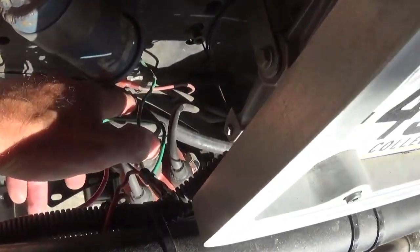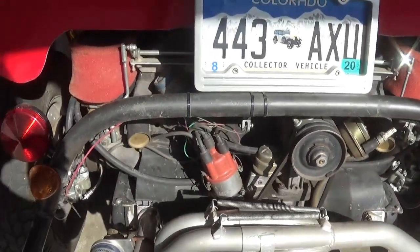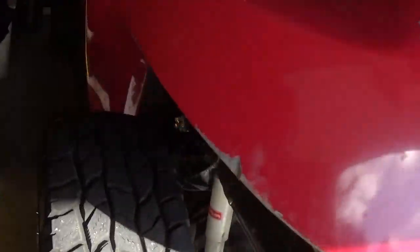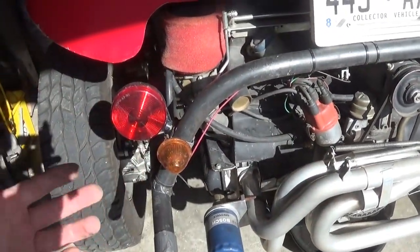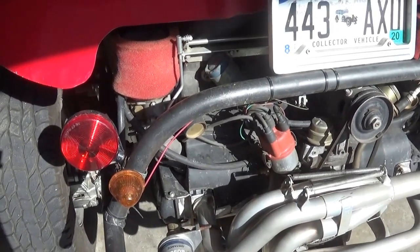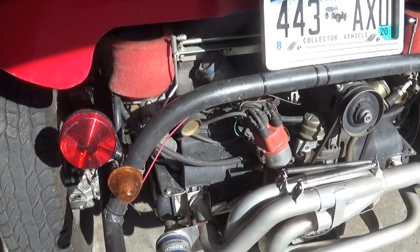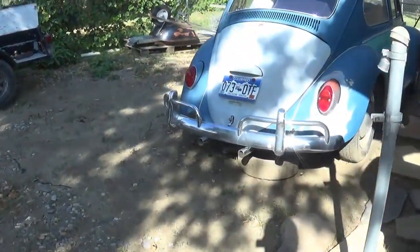Here's another similar situation: the tub buggy now has an electric fuel pump, and this is just a dummy to keep junk out. I have the rubber hose looped back to itself because I had the 1800 in here, so I installed a fuel pump and a fuel regulator — the low-pressure model. I like it because you don't have to pump the car to prime it; the electric fuel pump fills the float bowls and a couple stabs and she settles right down and idles nice.